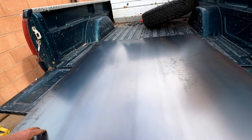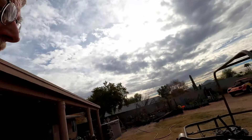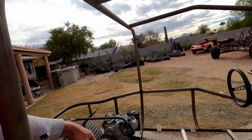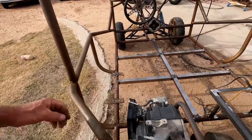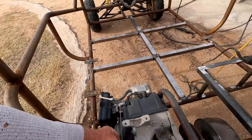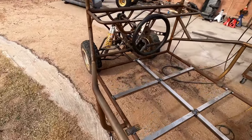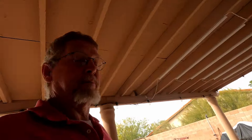The welds look real pretty except for that one spot. I'm going to cut this plate — it's mostly cut to size but I've got to notch it where needed and get it put in today. Tomorrow I've got to order the master cylinder, which takes a couple days, and then I can work on the shifting mechanism — that has to be mounted down there with linkage under the seat. I also have to figure out a gas pedal. There's not much throw on the throttle, so I'll need roughly a one-to-four ratio cable setup.